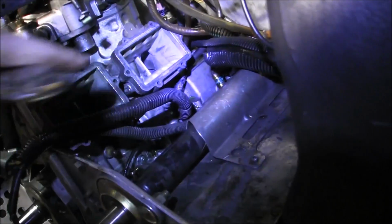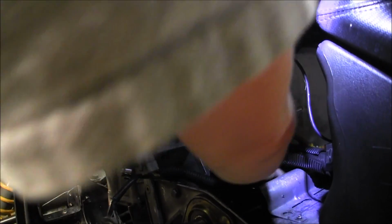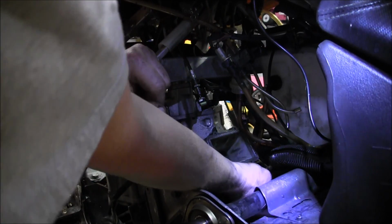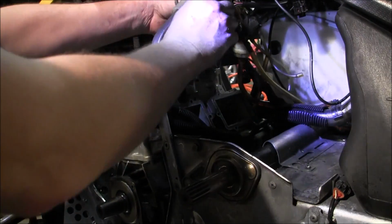Alright. Right now, getting fuel pump line off the motor. Pumps the fuel pump. That clamp. Smallest pliers you can find will help with that. I'm gonna get that line off of there. A little bit of a twist and pull. Alright. Fuel pump line is off. This radiator hose fits really nice right there. Tuck that SOB in there. Get that out of your way. Alright, I think we got everything. These lines go to the motor. Try to get everything out of the way.